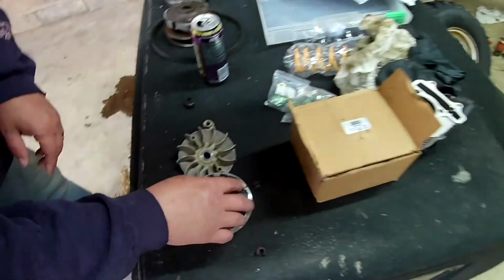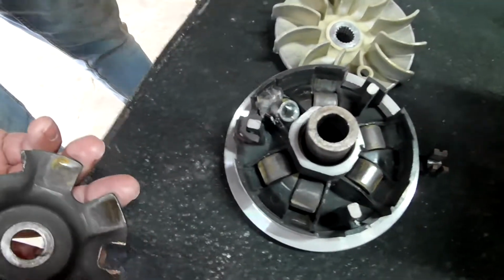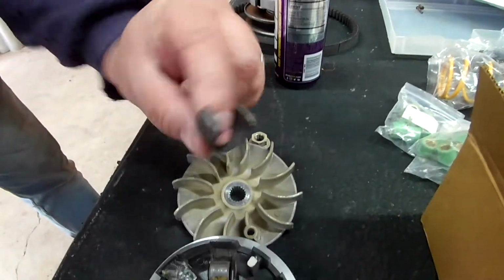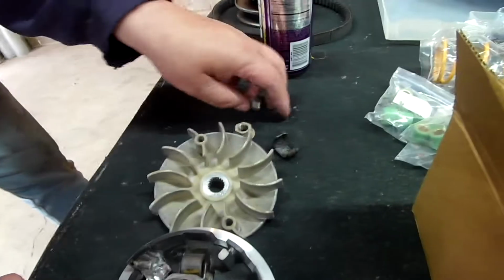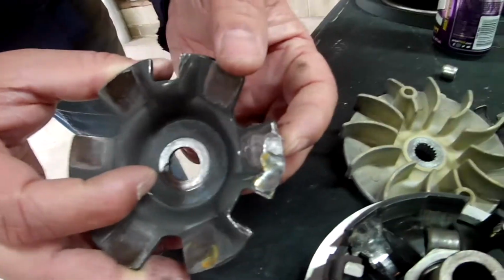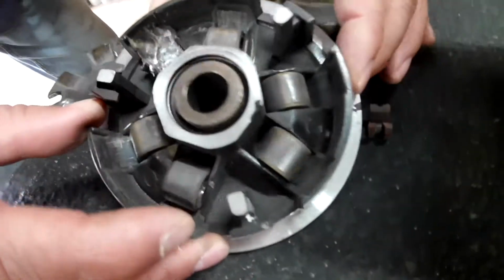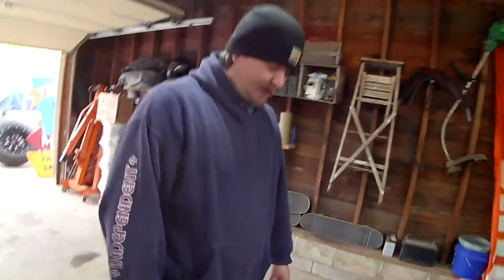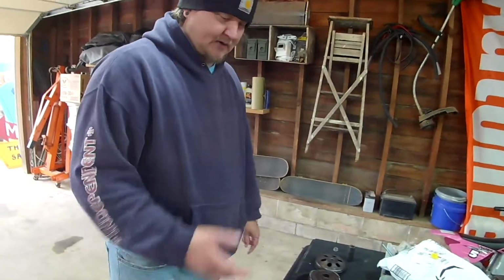So in every project you run into fun stuff. I got the transmission all apart, tore into this thing, and we got some issues. This roller is completely destroyed, and I actually found the casing was in a different part. It's completely destroyed our housing. It jacked up this part of the housing. And I was even looking at right there on all 3 of these, it's been eating through. So even if I clean this up and put it back together, that's junk as far as I'm concerned.